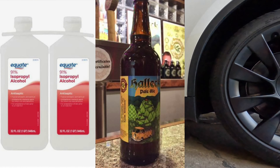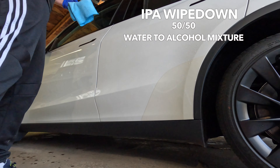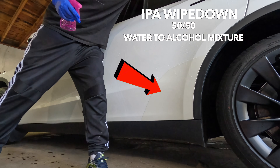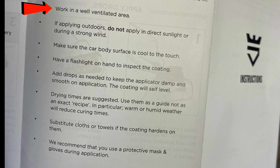Next, we'll get to the front and dry it off. Then we pull the car into the garage for an IPA wipe — we want a cool paint surface. IPA is isopropyl alcohol, not a tasty small batch refreshment. This cleans up everything that was left behind from the car wash, clay bar, and drying. Oh, when you see that ugly nasty yellow PPF? I swapped that out in an upcoming video — make sure you subscribe so you don't miss it. Okay, wash steps complete. Time to apply the ceramic coating.